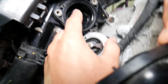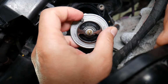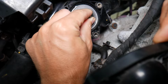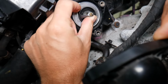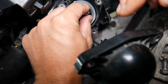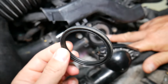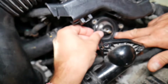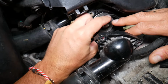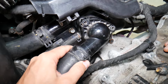If you look at the thermostat housing, right here, there is one spot where that tooth will go. So when you install it, it's super important to align everything. It will stay there, perfect, just like that. Later, you will need to get a new seal, we'll put the link in the description of the video below where you can get the thermostat and seal as well. Just like that, you're going to put it on top, it goes right there, and then you close it, and you install the three bolts.